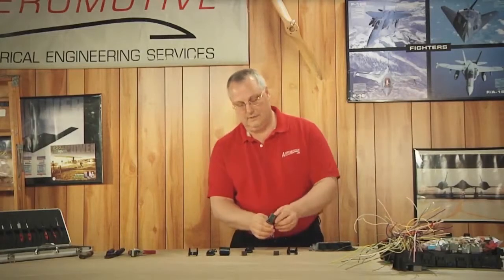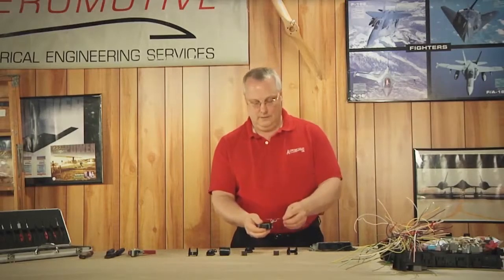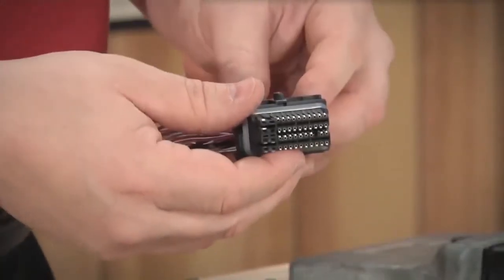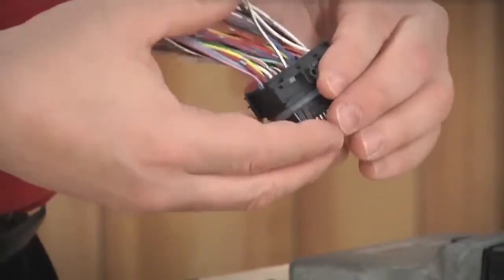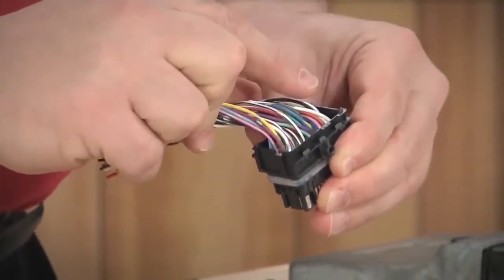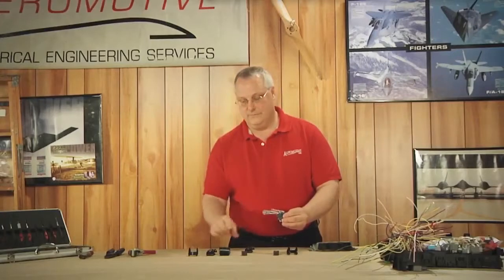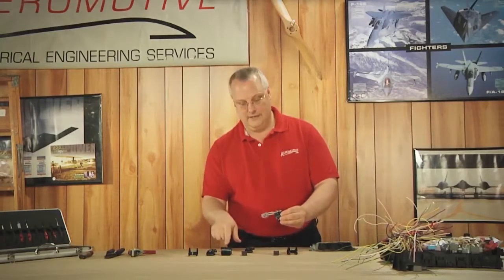Now look at the accessibility you have. From here on, it's just going to take a lot of patience. You're going to want to take a wire and it's always best to start with position number one. Look at the connector — they're usually numbered. You can flip it around and look at the back side for alphabetical or numerical codes. Pin position is critical. Once you take a wire out, you should have your replacement connector ready to drop it right into the new connector.